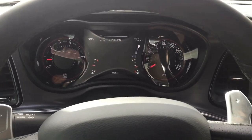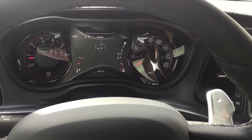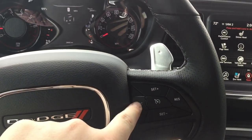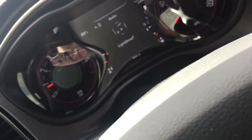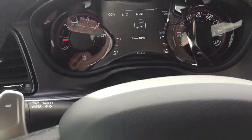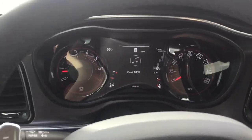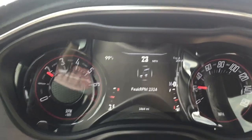All you've got to do is go to the audio screen and hold this button. To navigate, you press the cancel button. As you can see — light show, pressing it — then you scroll through to peak RPM, which is one I can use. I can just let go now. I'm going to put it in drive, and you can actually see it'll show the RPM every time the transmission shifts.